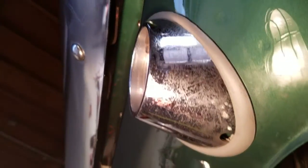Up in the floor, these inner splashes look good. The one-inch rubber plug is there — that goes to the reverse lights. By the way, the reverse lights are currently not working when the car goes in reverse. Drain plugs — the holes are there but the rubber plugs are not; those need to be replaced. Fuel tank looks older and original. You can tell those reverse light lenses are original, and that rear bumper might be an original piece too — the bottom side of it doesn't have the reflective quality that the rest of it does.